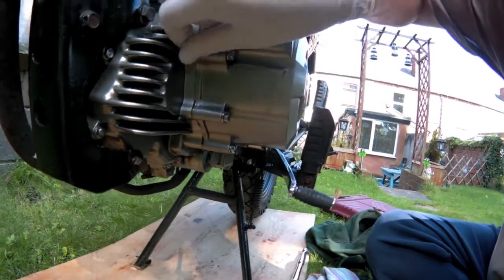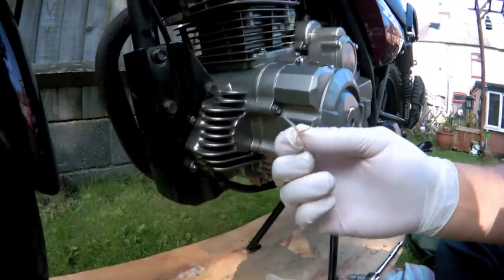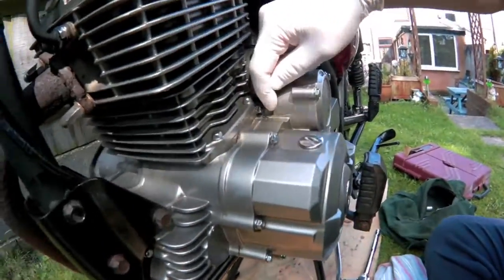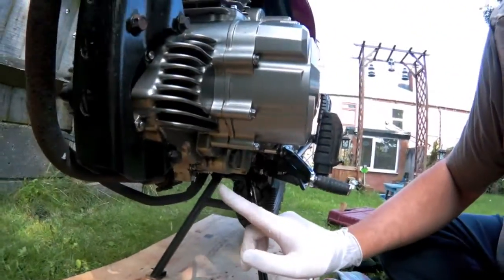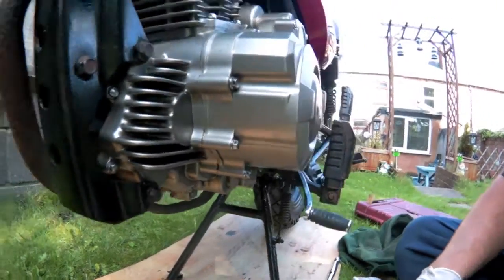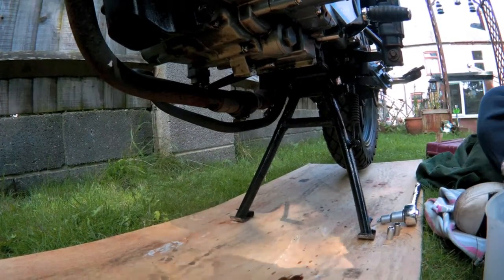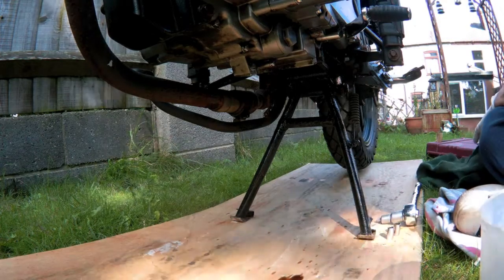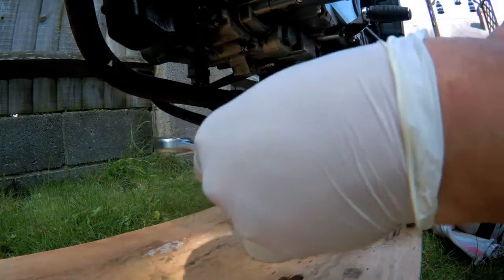This is just some really like silicon jobby. There's a crack up there which I've noticed, and you can see the oil dripping out from this gasket. I bought a gasket, so I'll drain the oil off first. Apparently you need to warm the engine up first, which I've just done. Now I'll take the sump plug off.